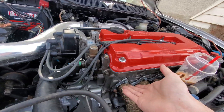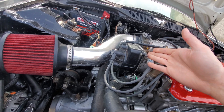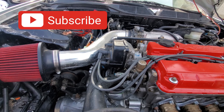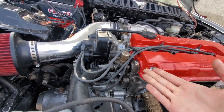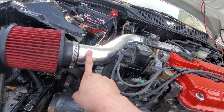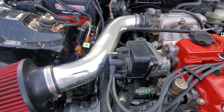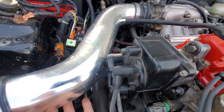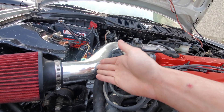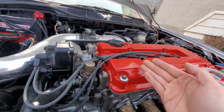How's it going guys, quick video with my B series swap here. I got a few questions on the distributor. The world is in shutdown mode, parts are not being delivered, but I want a race car. So I'm using my D series intake tube for my Y8. A few people noticed there's a bit of touchy touchy going on — that's because I'm using a D series intake with a CRV distributor on my b16a2.